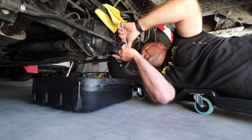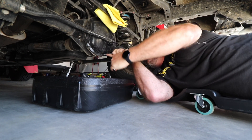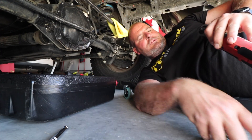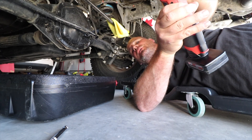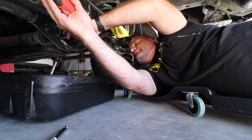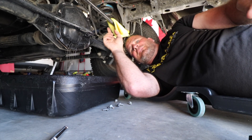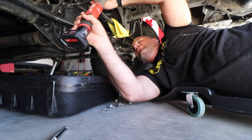Keep in mind, you're really not going to be keeping this factory lid, so it doesn't really matter if it gets scratched. Loosen them all up, then get the Milwaukee and take them all off. All I'm doing is I've taken all the bolts off the bottom halfway up, and I'm just loosening the top bolts to give that gasket some relief pressure. Let's let the oil drain out and we'll inspect it.